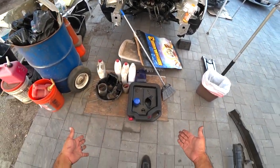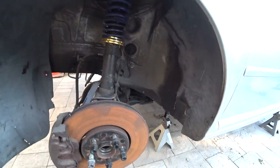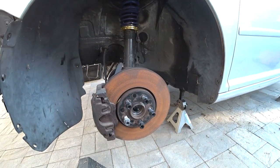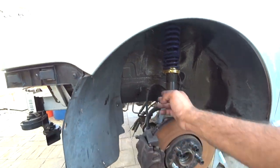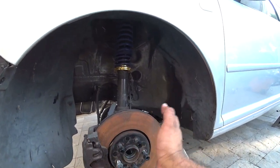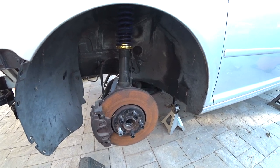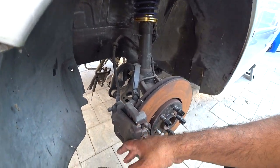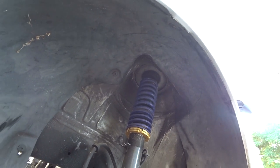The first thing we're going to do is actually clean my workspace up. Our next step is to remove pretty much the front suspension. We're going to have to figure out where to keep the caliper out of the way. We need a safe spot so the caliper can be mounted so we don't pull on the brake lines and damage those. We are going to be replacing them, but we don't want to damage them and cause a really bad leak. So we need to figure out a good spot because all of this is going to be coming out. First thing is first — we're going to remove the caliper first.